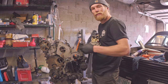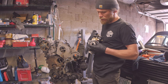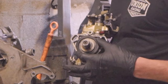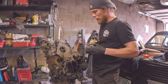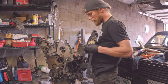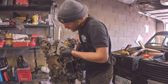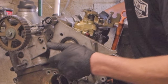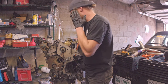My update today: homie Josh printed me off a spacer I designed. It's a teeny bit looser than I was hoping for — there's probably a half millimeter of play in it. I wasn't sure how accurate the printer was going to be. It goes between the pump and the bracket. Together they work such that the pump is now set in relation to this plate, not just the bolt holes. I can't quite test how it's working because the pump doesn't sit flush, so I'm going to start by trimming the back of this cover.